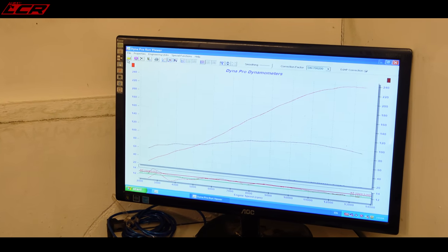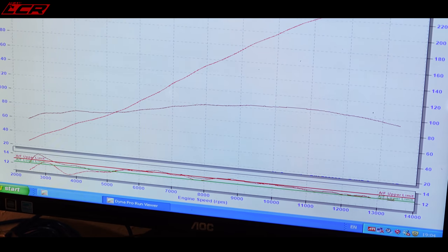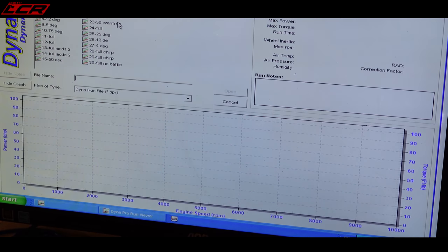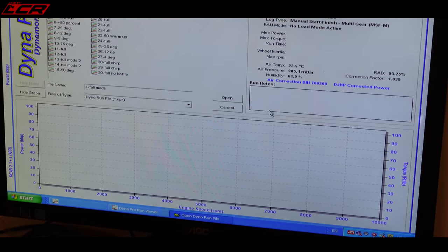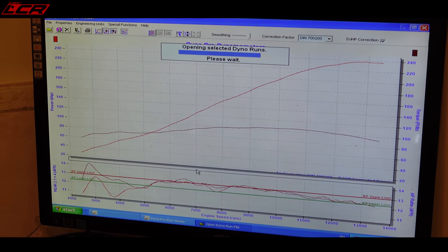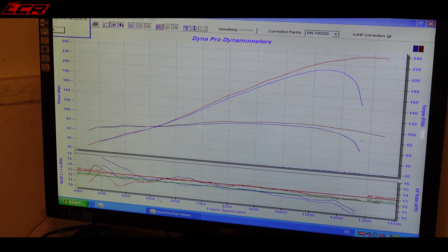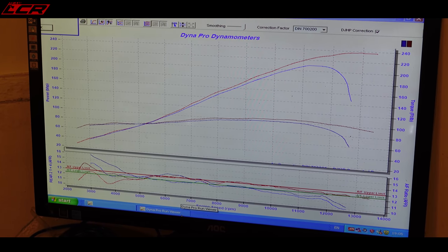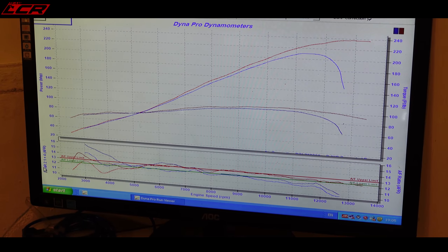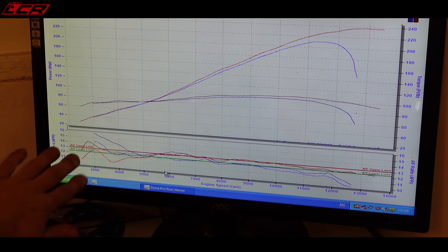So there we go. That's it. Finally, all the cylinders mirrored. Oh, wow. And if we look at how it was in the beginning, it was that one there. So that's before and after? Blues before, reds after. Look at that. Look how lean it is at the very lower end of the throttle range as well. They're right at the bottom, really lean.